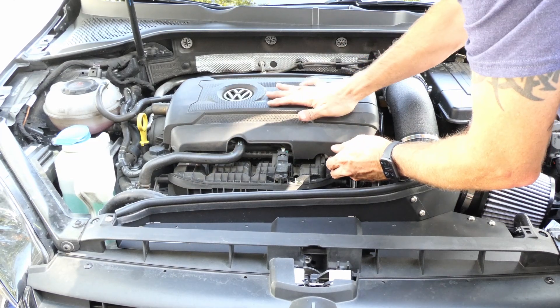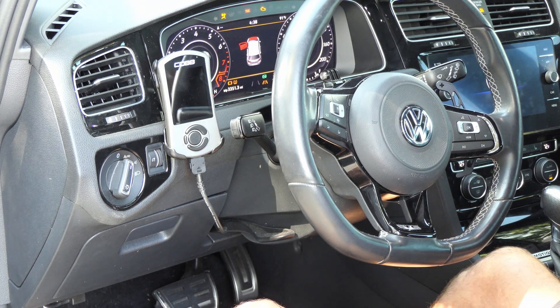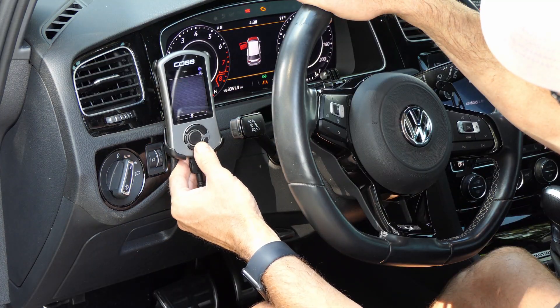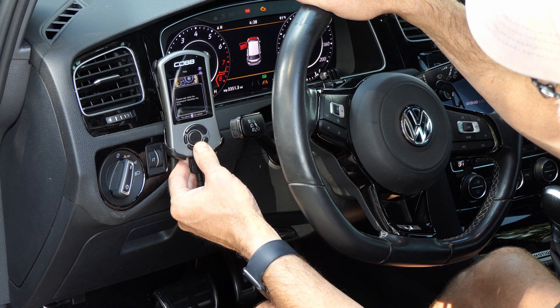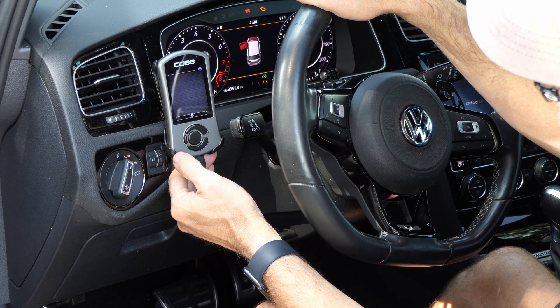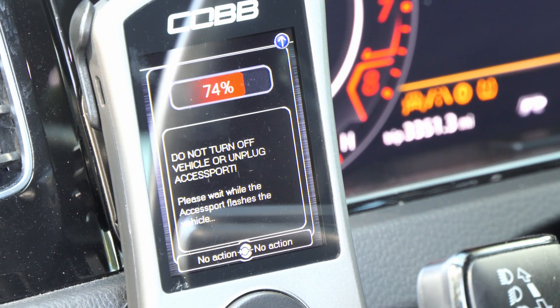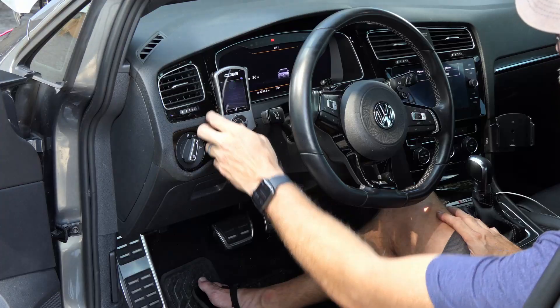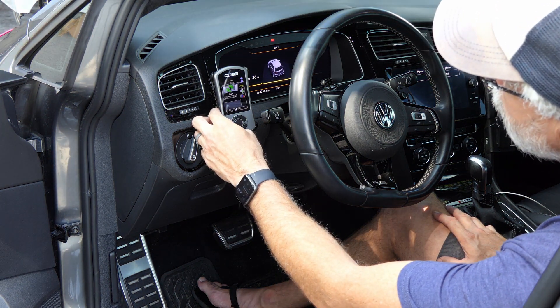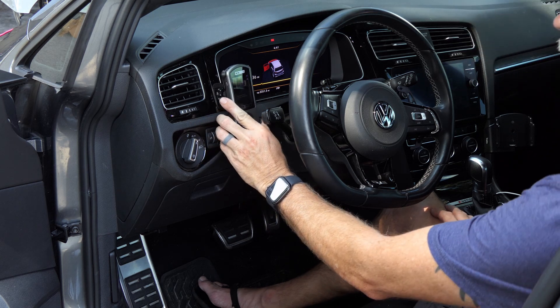If you're running somebody's tune and they give you advice specific to your tune and vehicle situation, it's probably a good idea to follow that advice. I'm just reflashing my existing tune — it's actually a lot faster than unplugging the battery to reset all the learning. It literally took like two or three minutes tops to reflash my current tune. If you already have the tune installed, it's really fast — this is real time, I didn't speed it up. That is it — installing the RS7 spark plugs and unplugging the O2 sensor. Thanks for watching, I'll catch you on the next one.